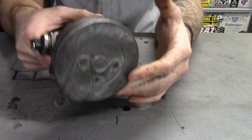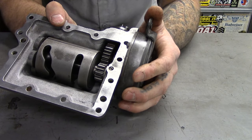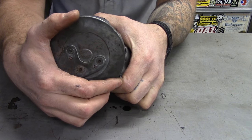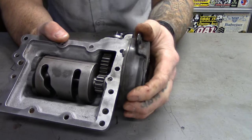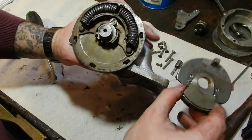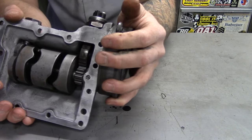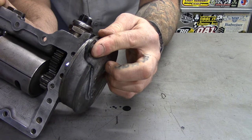The beauty of the ratchet top lid is it's still the basic construction of the old jockey lid or tank shift drum, but now you have this ratcheting mechanism which returns the shift plate to center. As you're going through these gears there's a return and it comes back. There are springs in here and some shifter pawls that engage each gear. As you ratchet through the gears, you can see that your shifter comes back to center.